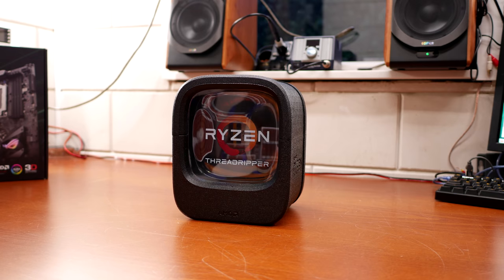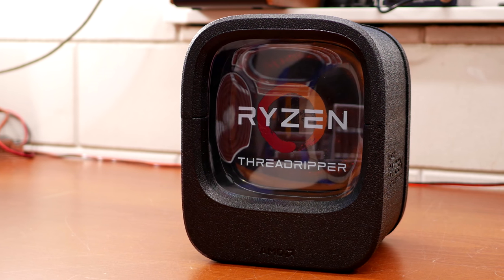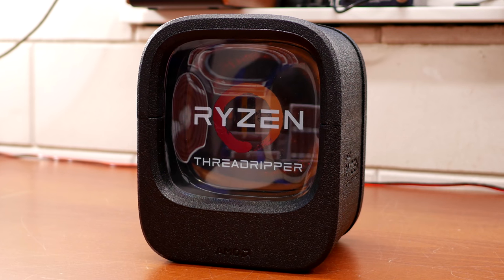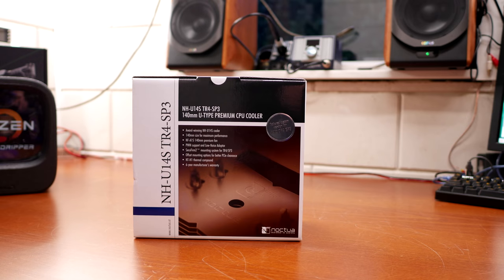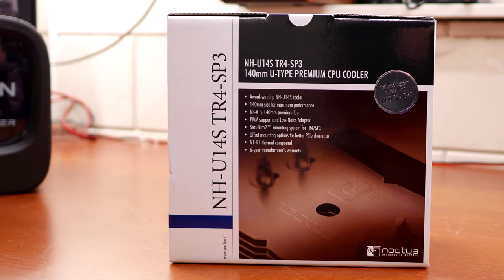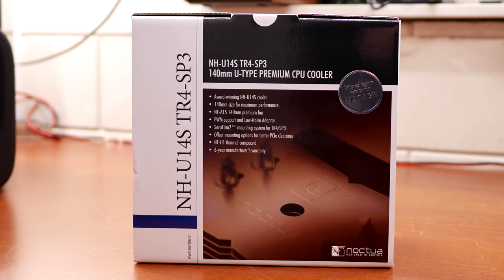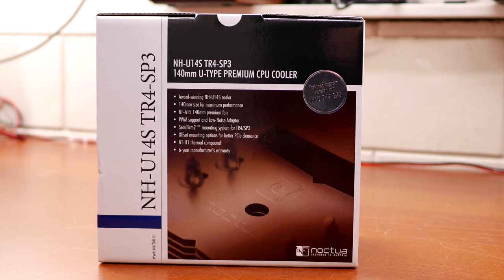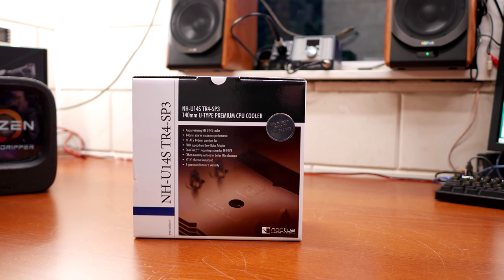The choice for the CPU was already obvious. An AMD Threadripper 1950X, which has 16 cores running at a base frequency of 3.4 GHz. And given enough thermal headroom, it'll boost up to 4.1, giving you excellent performance. To try and cool this monster of a 180 watt stock TDP CPU, I chose the Noctua NH-U14S TR4 edition. I am hoping this can provide enough cooling so that the processor can use its turbo all the time, but also has enough cooling performance to survive long render sessions. I didn't go with water cooling in this build, because this build is more silence focused than overclocking.